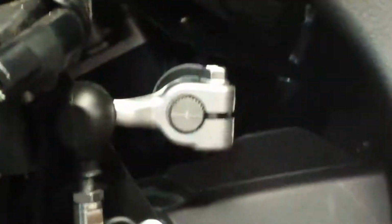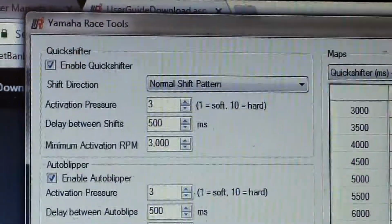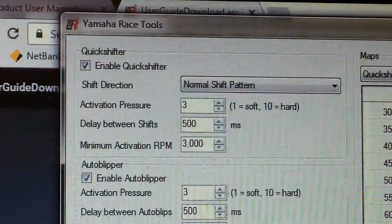All that is just swapping that around 180 degrees. So you'll spin it the other way, so it does the opposite of what it normally would. So that would take a little getting used to. Yeah, that's right. I don't recommend it to a novice because you could go over the bars in a real hurry. So right, we've set this up.